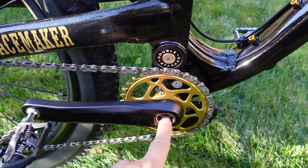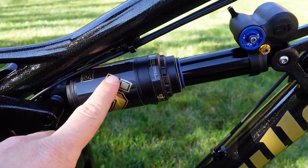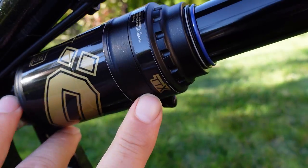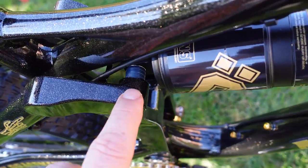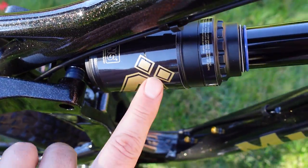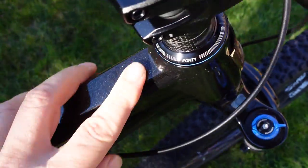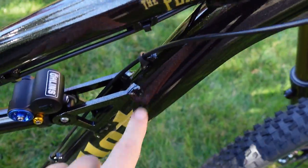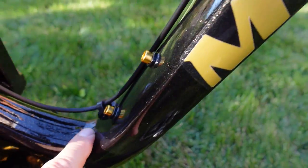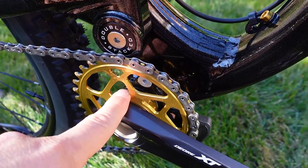The main pivot is right on top of your bottom bracket so you don't push into the shock. The TTX air shock is the more expensive version Mullet offers, attached to the swingarm using needle bearings and color matched with the bike and fork. You can also see the hydroformed top tube with a neat weld at the head tube, and the hydroformed down tube tapering down to the bottom bracket box.